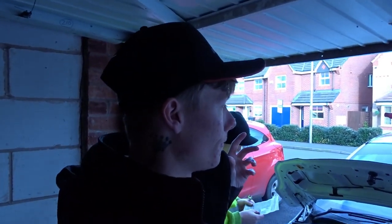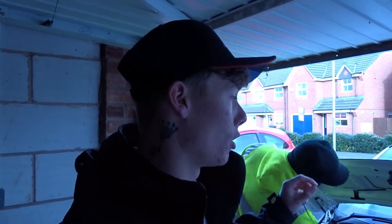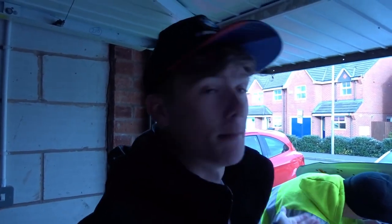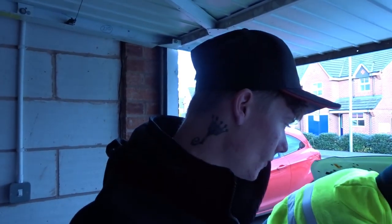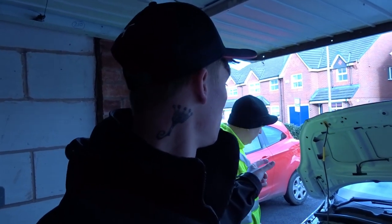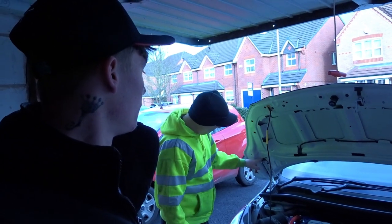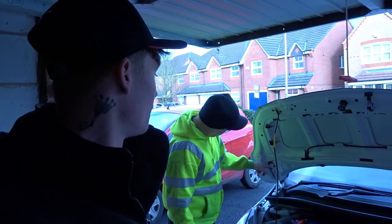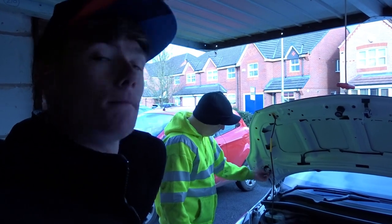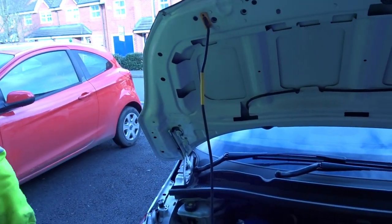So basically, Cliff's just reading the instructions again, just to make sure everything's done proper, so nothing's going to mess up. We've put the clips on proper, what are supposed to be on, like the little chrome nuts. He's done everything proper, so he's going over all the work, like any mechanic does, to make sure everything's right. He's just read the instructions again about loosening something on the bottom nut to adjust the strut alignment here, because we want this bracket to be straight, so not at an angle. Hence why this is here, so it's a stop. So I'll loosen this one up so we can get this bracket straighter, so it's not fouling this. But personally, guys, I think it's a good mod.